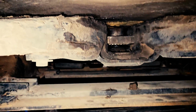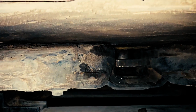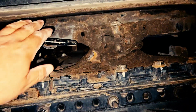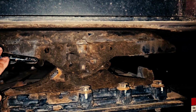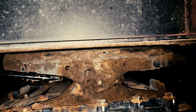I would also ensure that between my upper and my lower fifth wheel there's no space in between, just a grease in between. There should be no daylight whatsoever. You can also use a flashlight to shine through, see if you can see something. But you can see right here we have no daylight. And since my release handle is in the lock position, because my lock jaws are securely locked around my kingpin and my trailer is coupled to my tractor, that's the proper position.